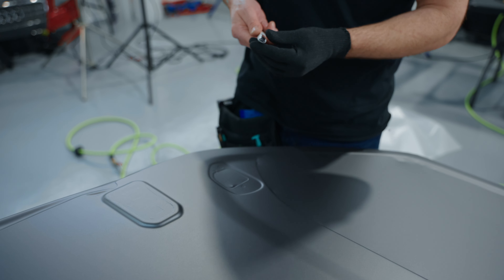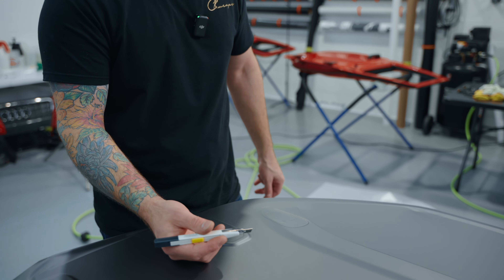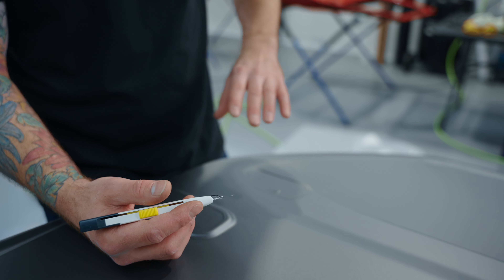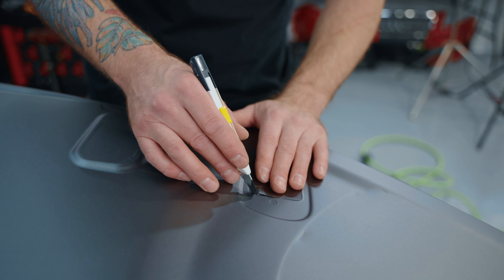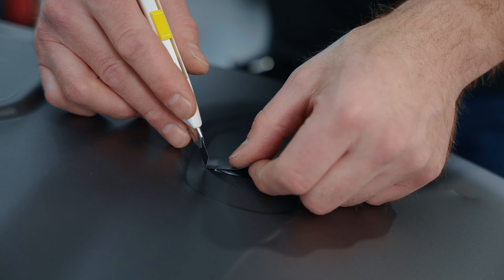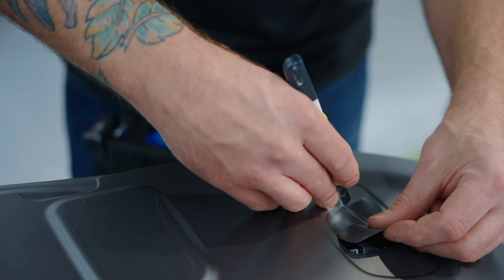The knife doesn't like to cut it and this is a fresh blade — I'll even snap one off again. I'm using Olfa black blades and I'm not using the 30-degree blades; I'm using the standard angle blades because I find these are better at cutting paint protection film — clear, cosmetic, anything. We're adding a little bit of pressure and then cutting through. Try and keep it sort of tight and that gives you a better cut. If you feel like your blade's not cutting it, it's probably because it's not a sharp enough blade, so get the sharpest blades you can.